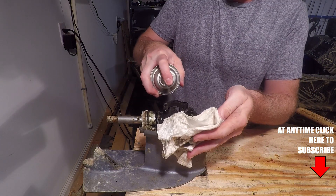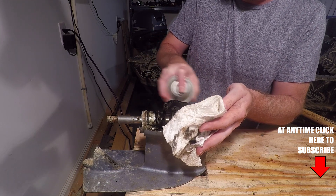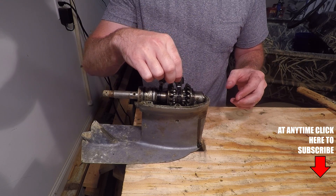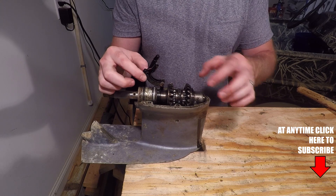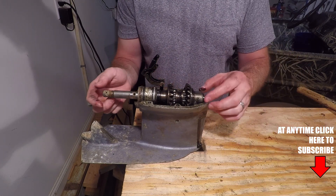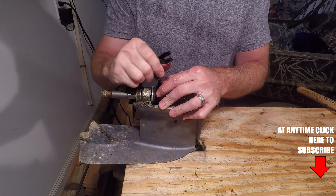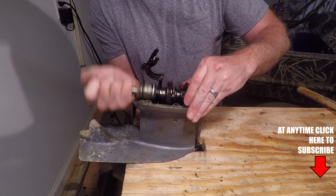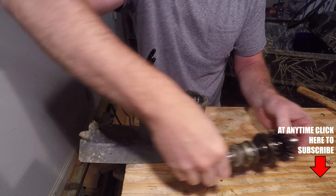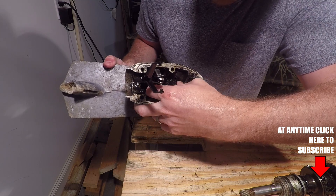I'm going to take a little brake parts cleaner and try to clean it off right here. Now to take the gears out, you lift up the shift linkage. This piece will come straight out of here — set it off to the side. You should be able to remove this whole gear train as a unit. You may have to pick up a little bit on the shift rod and it should slide out as a unit. Down inside of here you'll see the main drive cog.